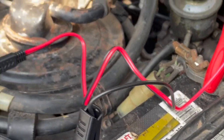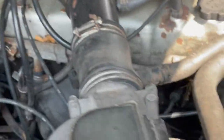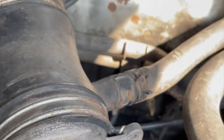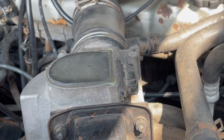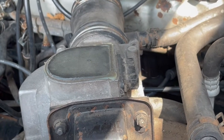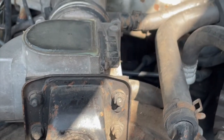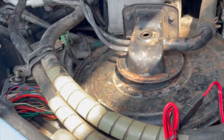We cranked it a couple times — it will fire with starting fluid but not by itself. Here's our fuel filter — this is the main feed to the engine, it goes to the back of the fuel rail. The return line for the fuel injection is right there. Pulled it off — bone dry. So it's not getting fuel, corroborated by the fact that it starts with starting fluid but nothing else. The gauge is pretty close to empty on the dash, so we're going to get five gallons of gas and throw it in there. I'm pretty sure it's a fuel pump issue. All the fuses were good but I didn't find a fuel pump relay, so that'll be the next step.